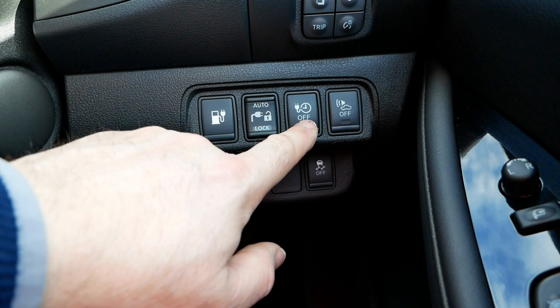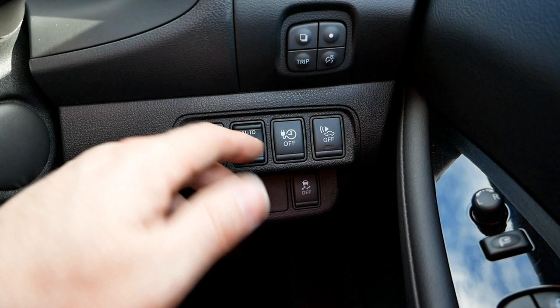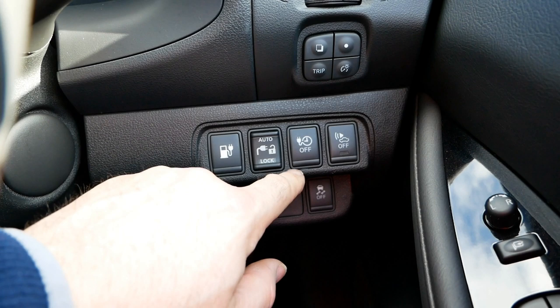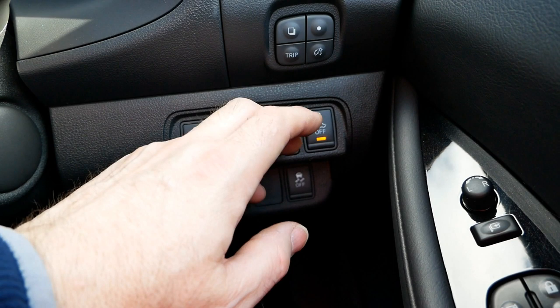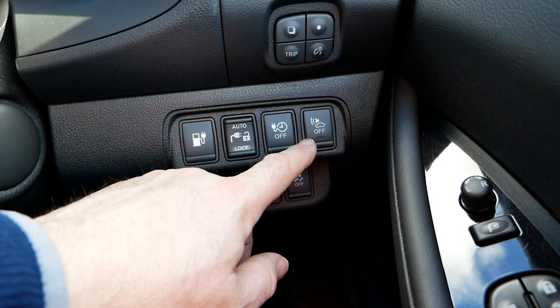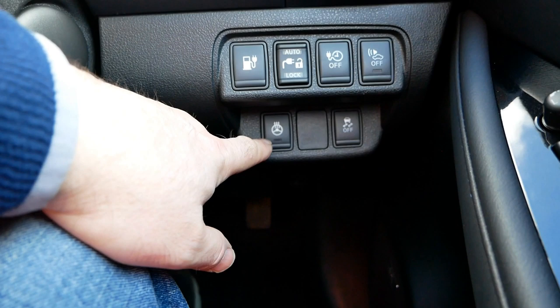This button takes off a charge timer — if you've got a charging schedule set up and want to take advantage of a nighttime cheaper energy tariff, when you plug in it delays charging until that tariff kicks in. Pressing this button turns off any timer and allows the vehicle to charge immediately. This one is your front audio system — it plays a tone out the front when you're driving below about 19 mph so pedestrians and cyclists can hear you. You can turn it off for stealth mode, but it always defaults back to on every time you start up.